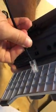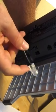So plug that into the network. Something I've noticed about these Cisco voice over IP phones is that the RJ45 port is very deep. So it's important to have patch cords that have the longer tabs on them.